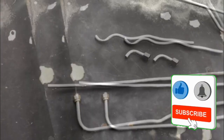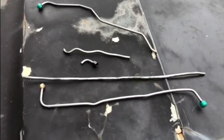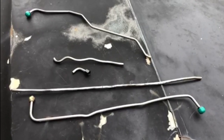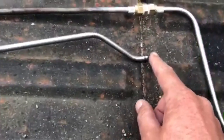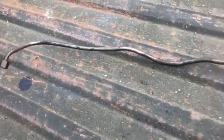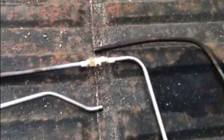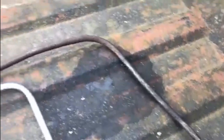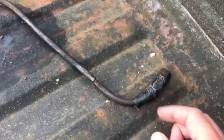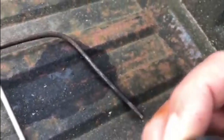Because the pipe doesn't fit, I've cut them both into pieces and I'll join them, then put them under the car and connect them to the gearbox. I've cut the new pipe here — that's the remainder of it, so you can see how much shorter it is than I needed. I also cut off this length from the old pipe because there was a slight leak coming from around there. I cut that end off originally because that's the end that was cross-threaded and made a complete mess of. Then I joined this section of the new pipe to that section of the old pipe.